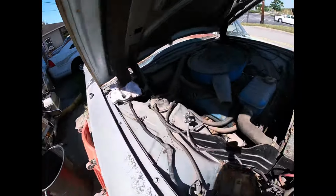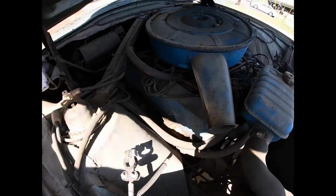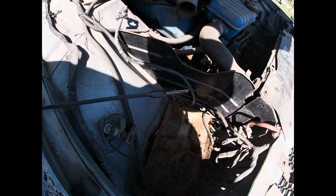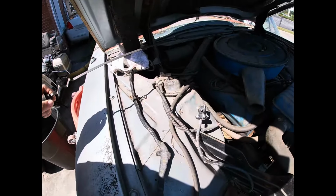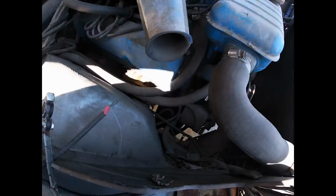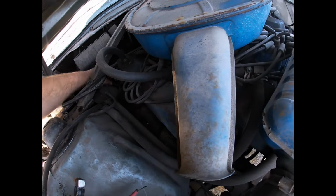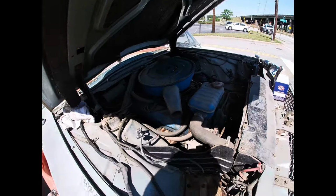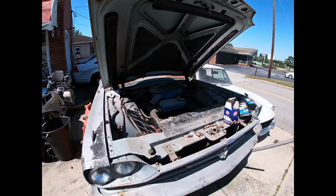I just checked the dipstick, the shifter, transmission. Man, I watched way too much Vice Grip Garage. That looks good. There's no moisture on that, which tells me it's not flood damage, if that makes sense. Usually if this thing sits in like a river, that transmission would be full too, and it is not. I am beginning to wonder if somebody didn't just pop this hood one day and shove a damn water hose in it, because that was 10 quarts.